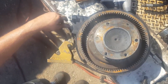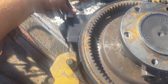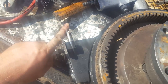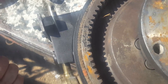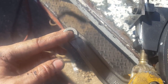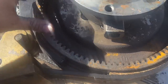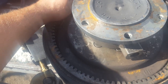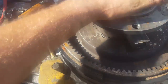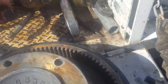Looking down at the top, this is how the setup looks. When you pull this and set the park brake, it pulls this up. It actually tightens this drum around the outside. This outside drum is connected to the final drive; this side is connected to the pinion — that's where it slips.